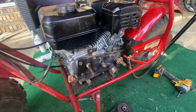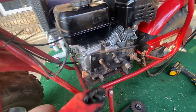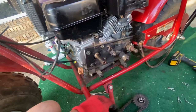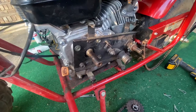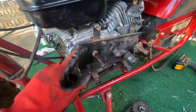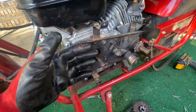All right, we got all this back together now. Almost back together. Got these all retapped, and I used that really good milled steel grade, whatever. I don't know what it was. It was a good bolt. And rethreaded, tapped all these. It started off small and went into the thread size that I needed, so it worked out perfect. Worked it in, cleaned it out, worked it in, cleaned it out, worked it in.